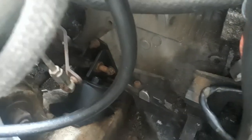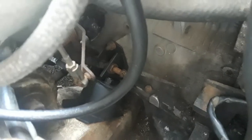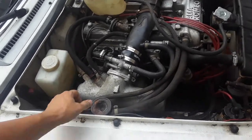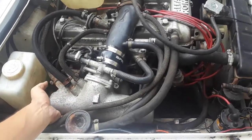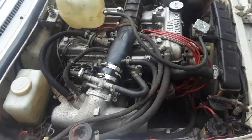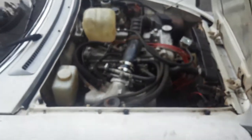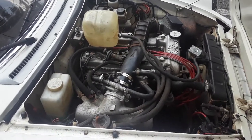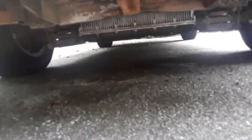On the passenger side there is one extra thing: a bracket that goes from the engine mount and holds the intake. You're gonna need an extra pair of hands here — once you're about to remove the bolt that holds the bracket, you'll need somebody to either put some pressure on the intake or lift it, depending on what you're doing. A couple of bolts are accessible from the top, the rest from the bottom. This is where ratcheting wrenches really pay off because you have a lot less space to work, but it can be done.